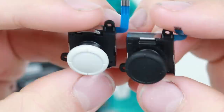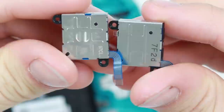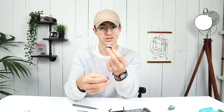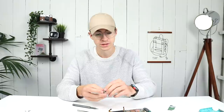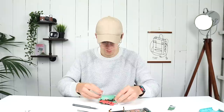Here it is versus the original Nintendo Switch. You can definitely see some differences in this metal shielding around it. I have no reason to believe that this one would not work in the original Nintendo Switch — and I'm actually going to try that. Because if this one has a reduced joystick drift tendency, then it might be worthwhile for people to swap them out. I think it's fair to say they have focused their attention on the problems at hand and have done some sort of revision to the joystick. The drift was really just down to the build quality — all the different mechanisms used for the joystick to swing back to the middle is obviously what caused the problem. They would have remedied that by using higher quality components, which costs more money, but it's worthwhile so they don't have a problem replacing everyone's joysticks later on.